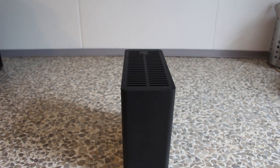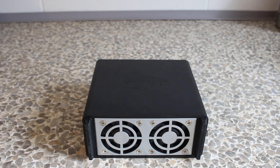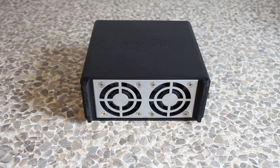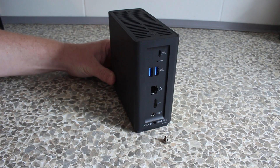It comes in a very compact design — really quite small compared to other NAS devices I have, because you don't have to support those big 3.5 inch hard drives. It's essentially a small plastic box with the motherboard for the CPU and memory, and on the other side of the motherboard are the four M.2 slots. In that compact design they've managed to add active cooling, which is very quiet at only 19 decibels at its lowest speed, blowing air over the CPU and NVMe drives.